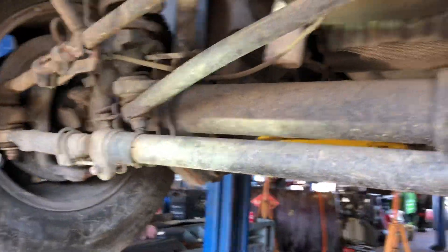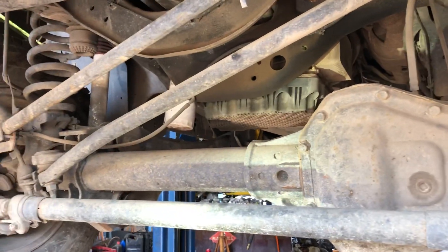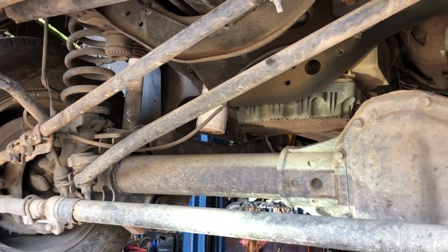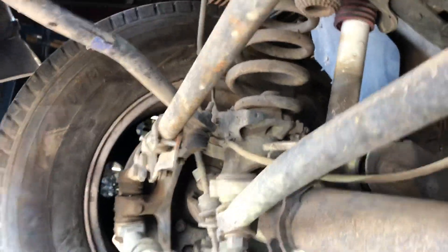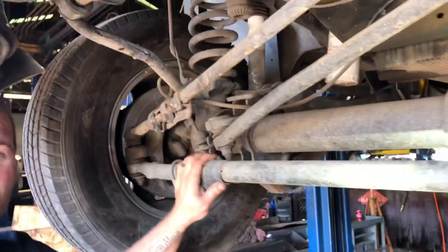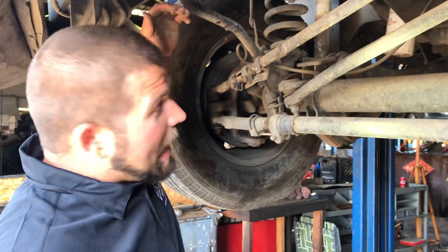Sometimes radius arms, like on Dodges, will be considered control arms — they might on these trucks as well. But on Jeep Wranglers, some Ford Broncos, and some of those F-150s with the twin I-beam front suspensions, they call those control arms. They're also in PowerLink, but their actual name is radius arms. That is this arm back here that goes back to the frame. Sometimes you do find those under 511 and 512. If you hear somebody call and say that thing had four-link suspension, a lot of the time what they're talking about is four radius arms. On older vehicles, if this vehicle had a leaf-sprung setup, you're not going to have radius arms — your leaf springs are going to take the position of the radius arms.